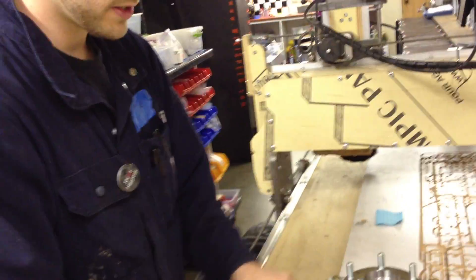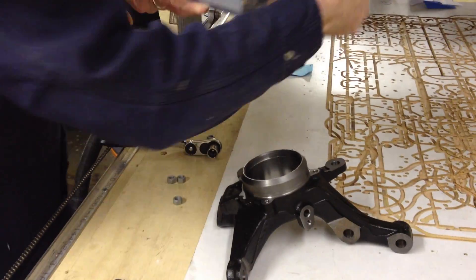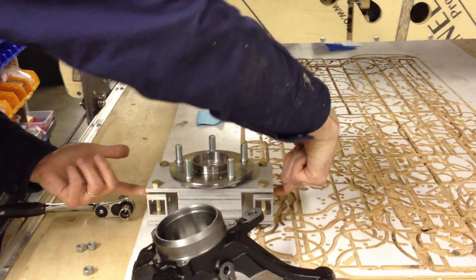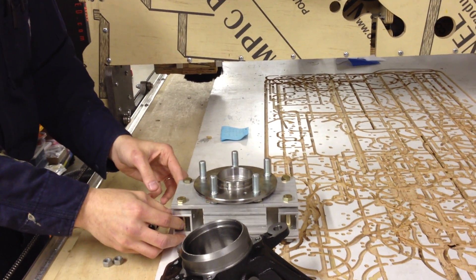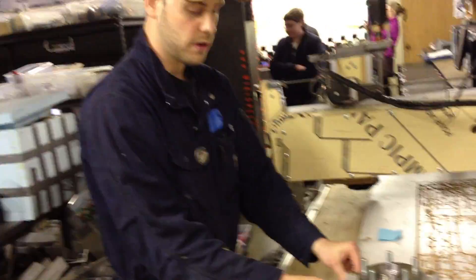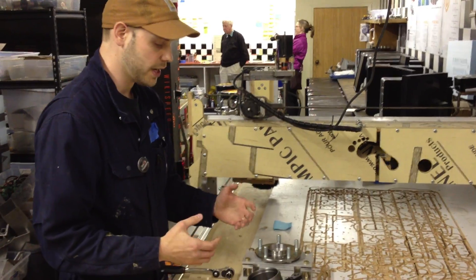The connections on here — normally you'd have a McPherson strut gripping here and a pivot here so it can turn. Well, we have a hole in the top and the bottom — in fact three holes — which let us adjust caster for the upright to pivot upon. Also, that's a module, so this is not tightened down, but you can swap this with any other type of piece without changing the entire knuckle. You could have an integrated bearing if you wanted to, or use it like we are now with nylon or Delrin washers for a very inexpensive pivot that stands up to the weight of the knuckle.